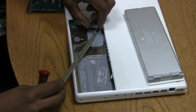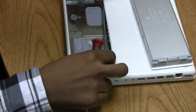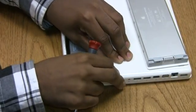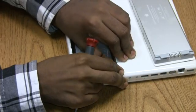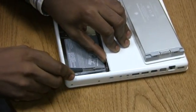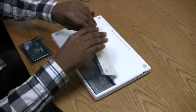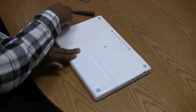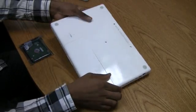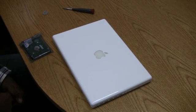Once you've got the chassis reattached to the new hard drive, simply fold back down the white tab and slide it back into its new home in the notebook. To reattach the brace, just slide it into its groove here, and because the screws never really come out in the first place, all you have to do is make sure they line up into the groove and then reattach them. So once you've made sure that the brace is secure, you can reinsert the battery, give it a reverse 90-degree turn with the quarter, and it snaps right back into place. Voila — you're all done, and your MacBook now has a new hard drive, so you can install a fresh copy of Snow Leopard and, if you have it, restore backups from Time Capsule or Time Machine.